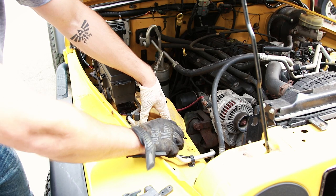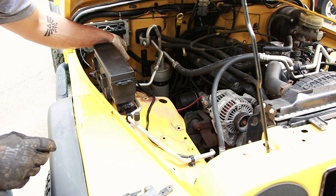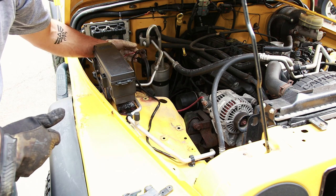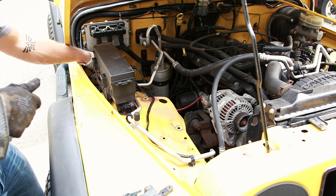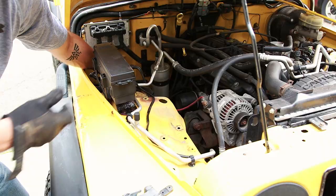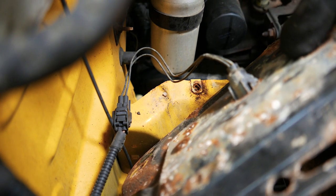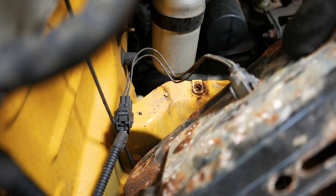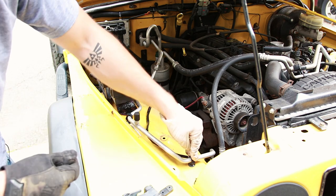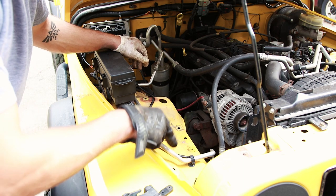We removed the air box filter — that was three 8mm bolts with nuts on the bottom. We removed the battery: there are two nuts that hold the J brackets on, so you take those off, disconnect the battery terminals, and then there are four bolts that hold the battery tray down — these are probably going to be very, very rusty. When you go to remove the battery tray, there is an electrical sensor at the bottom that measures the temperature of the battery. There are also three bolts for the fuse box that we need to remove, and we'll undo the plastic clips for the AC line before working on the bolts that hold the fender to the Jeep.